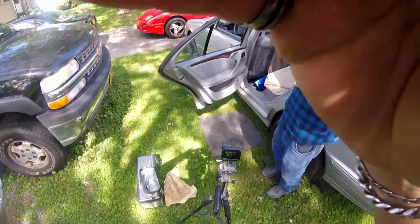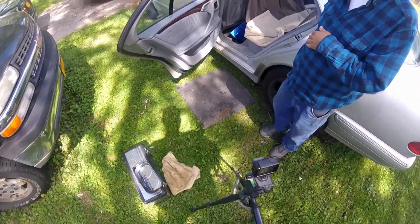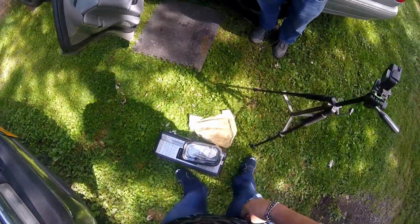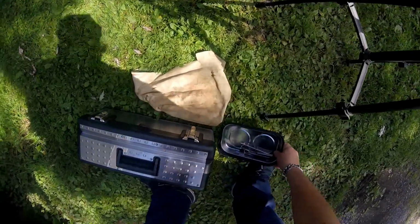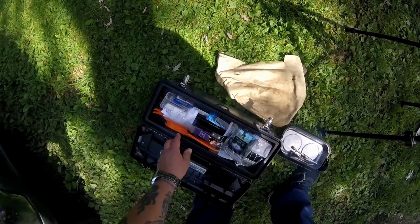Today I got a 2000 Mercedes E430, that's the W210 platform. I was driving, my dogs were in the car, and they wanted to look out the window, stick their heads out, and I opened the rear window and it never went back up. I hear the motor running, so I'm figuring the cable must have gone on the window regulator. So I've got to open this up now.